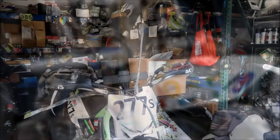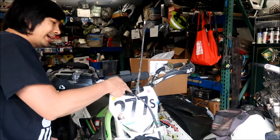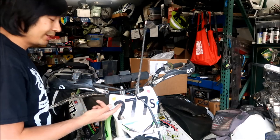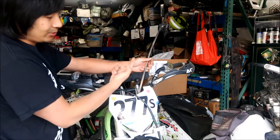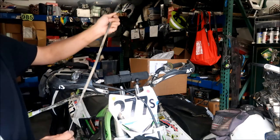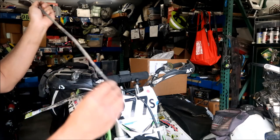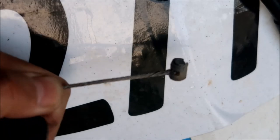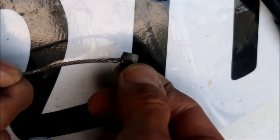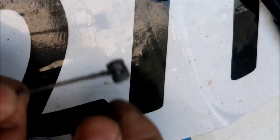It's just going to come right out. On mine it's to the left of the number plate area. Just pull it straight out and remember it was coming out this way and going straight into the clutch. Boom - piece of cake. I am surprised there's water coming out of here. Now that we've got it off we can look at the damage more closely - about half of the strands are already coming off. This wouldn't have lasted much longer.